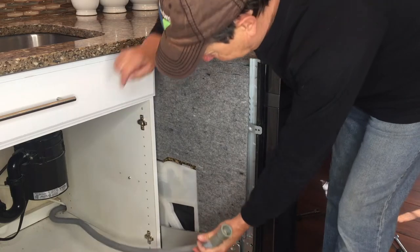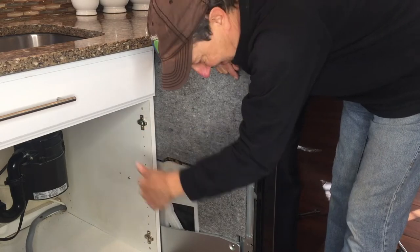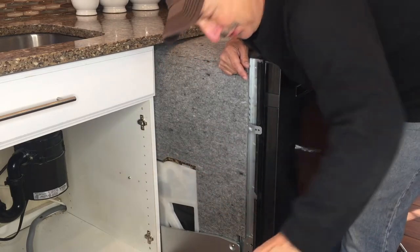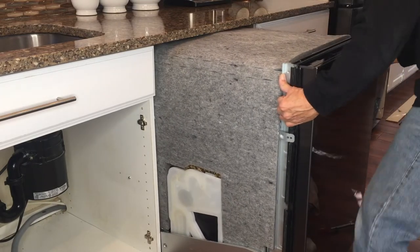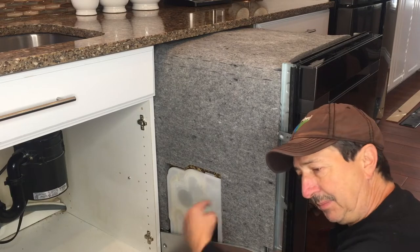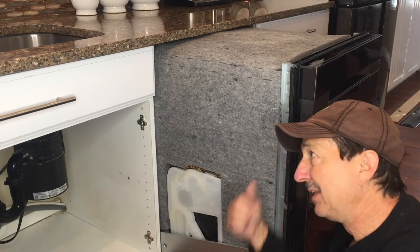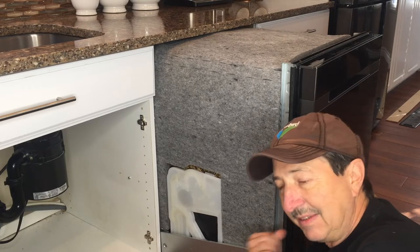This hose has to snake around the back. Depending on whether you disconnect the hose from the valve or from the front — I just disconnected the front to see if it was leaking. I've heard that people take this side panel off and use a little turkey baster to suck the water out of the bottom tray — but that's only if you're getting a little condensation tripping the sensor. No reason for me to do that here. As much water as I'm getting underneath, there's definitely a leak.